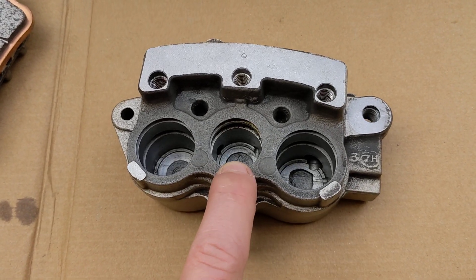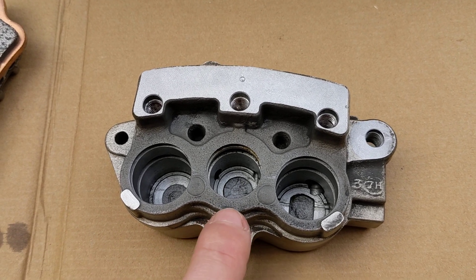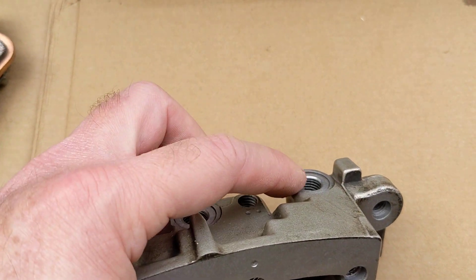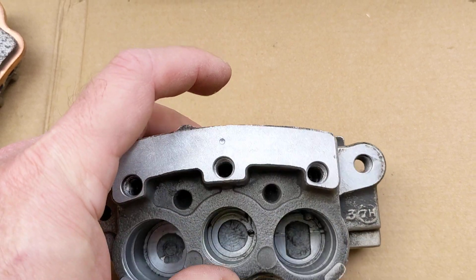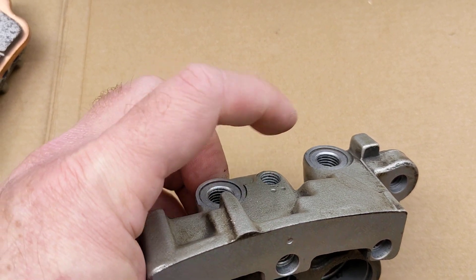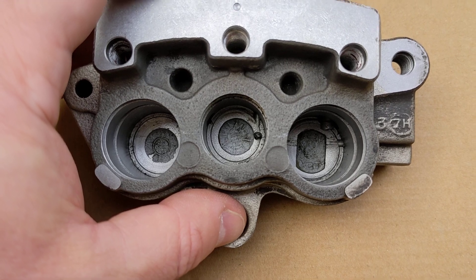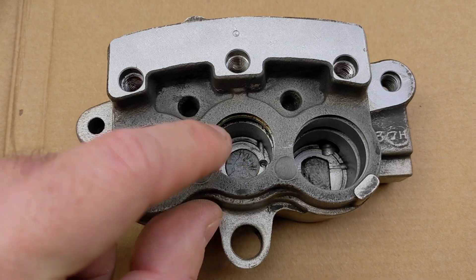Because I'm going to use it as a front caliper without any linked brake system, I need to somehow bring that piston online when the fluid pressure is coming in through the top attachment. You can do that one of two ways: you can either make a double hose that runs from there down to here also, so it applies the pressure to both — but that's a bit ugly, messy, and obviously going to cost more money. So I've drilled this one out to link the two together.